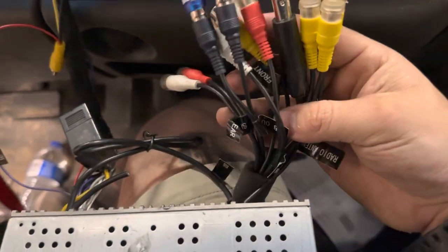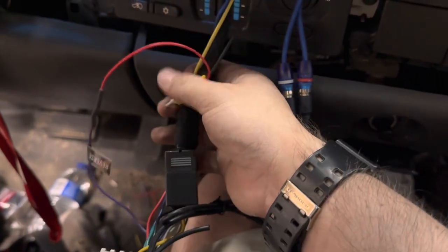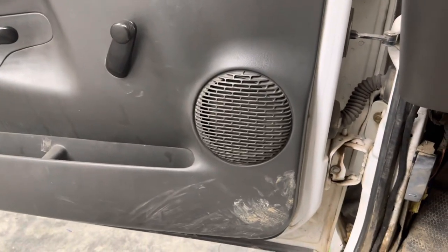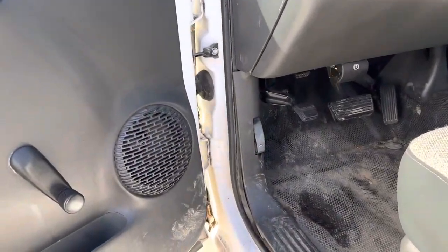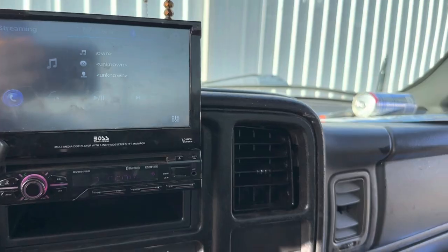I've got the radio wired up and the harness cleaned up as much as I could. This is an older radio so it has bulky connectors, and I'm going to add Tessa tape to a few more exposed wires — this one still needs to be connected to the backup camera, the remote turn-on, and the unused wires. Now we're replacing the door speakers — putting in the SCAR six and a halves. I got a little ahead of myself, so I already went ahead and installed it on one side. We got the truck all put back together with speakers and everything in, the custom bass knob, and the radio — all running. Now let's do a sound test.